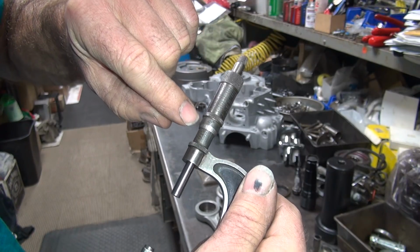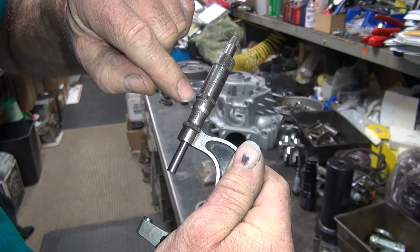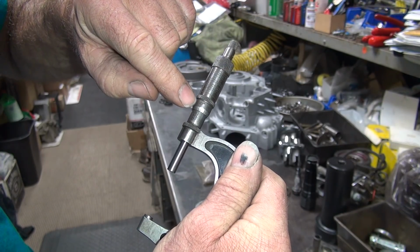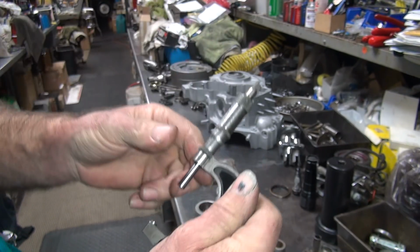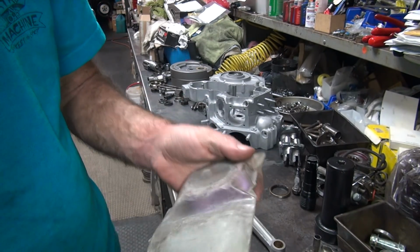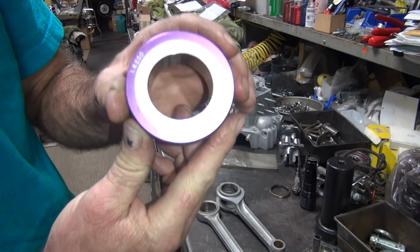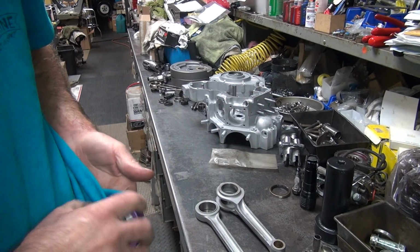You got 0 is 25 thou, or 0, depending on how you count it. 24 is underneath it, that'd be 1 down. You see about a third of the way up, so you know you're about 3/10. So that's how you know. Anyway, the checking standard is on size, which is 0. It's 1 5/8, in case you didn't know.